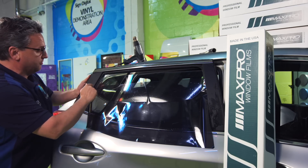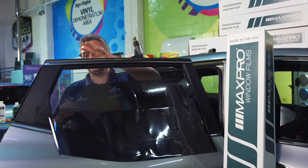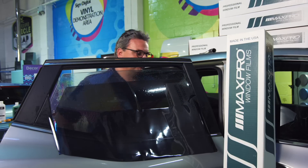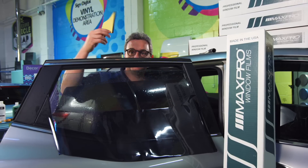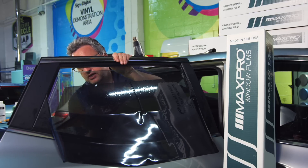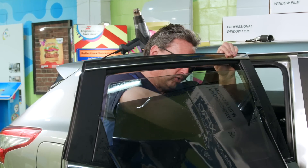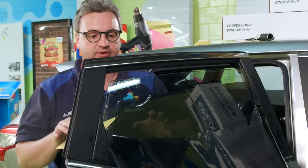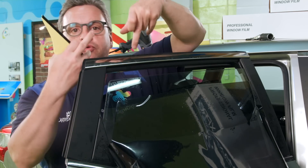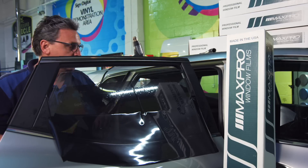Important thing is, of course, cleaning again. I've already cleaned it once but I want to do it again because I've opened the window and the door, so maybe there's some dust added to the glass. Again straight from down and up — it's a basic rule. In this case I'll use my Conqueror to squeegee it, because I want to only touch the edges and the rubber part one time. Squeegee it, but it's not cleaned all the way down, because I will do my inside installation now. When it's done from here and down to here, I still need to roll the window up. I want to clean it before I lay the film down, so that's why I will wait with the bottom part of the glass.